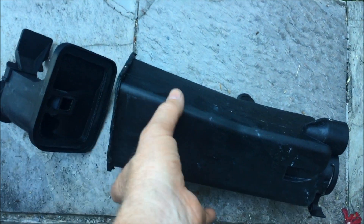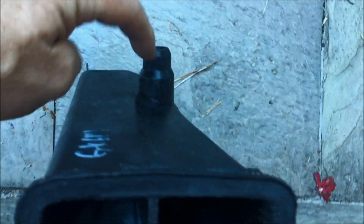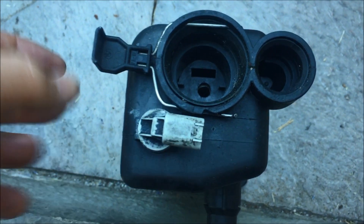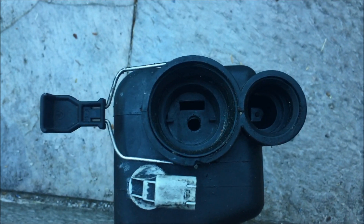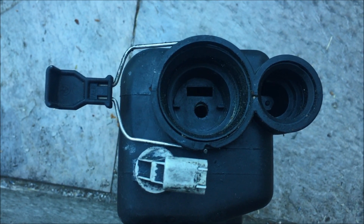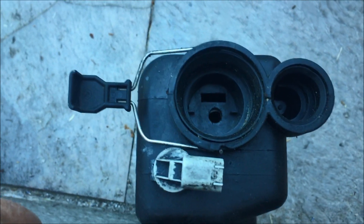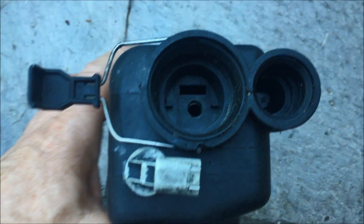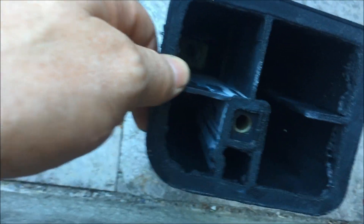This one blew the top off, so that was removed. When you're looking at this thing inside your car, you're going to be looking at it from the top. There's a hose that you're going to disconnect from here, and on the bottom the only thing to disconnect is an electrical connection. It has a rubber ring in it that just presses onto a part. You can do that without removing the bottom plate, even if your hands aren't small.